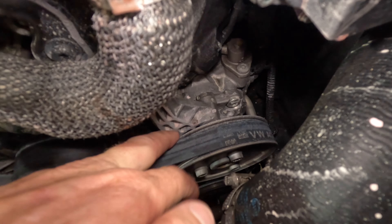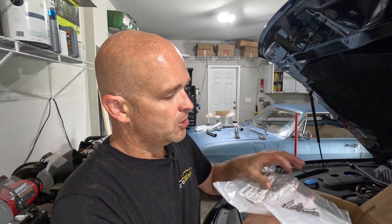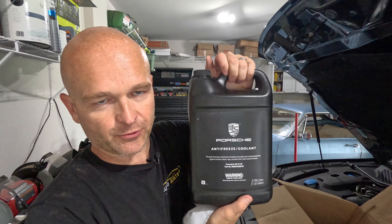It looks like my belt is also starting to go, so it's a good thing that we're doing this. I reached out to Pelican Parts and they actually have a water pump kit that includes everything you need to replace the water pump on your 958. I'm not sponsored, I paid full price for everything. It includes a brand new belt, a new water pump, new water pump bolts, and Porsche approved coolant — all in one package, one part number. I think it was a couple of hundred bucks and everything showed up to my door in a few days.